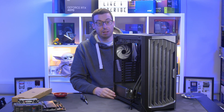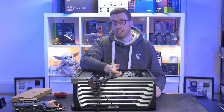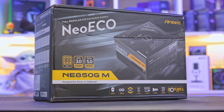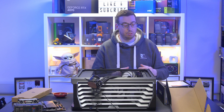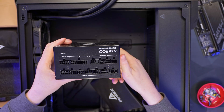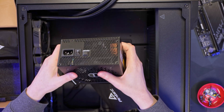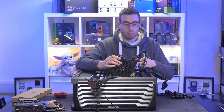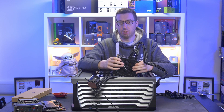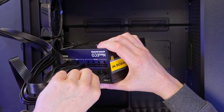I pass all the fan cables through to the back and get the power supply out so I can route the EPS connectors before the motherboard goes in — otherwise it can be tricky after the fact. The power supply is an Antec NE 850GM — fully modular, 80 Plus Gold certified, and ATX 3.0 compliant, so you can use the 12VHPWR connector without adapters. It also has an eco hybrid mode. The modular interface includes the 16-pin 12VHPWR and the bag comes with plenty of cables, velcro ties, and screws.